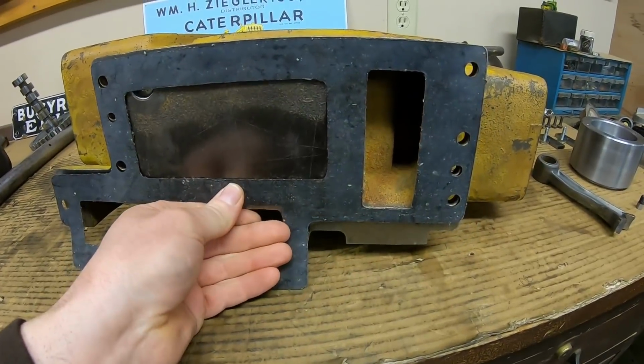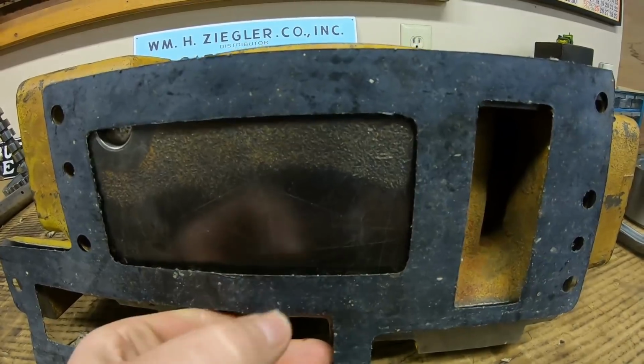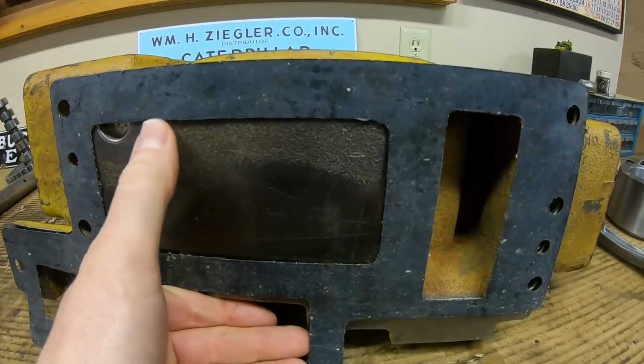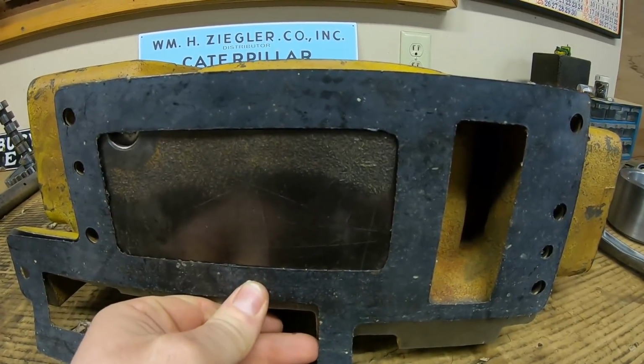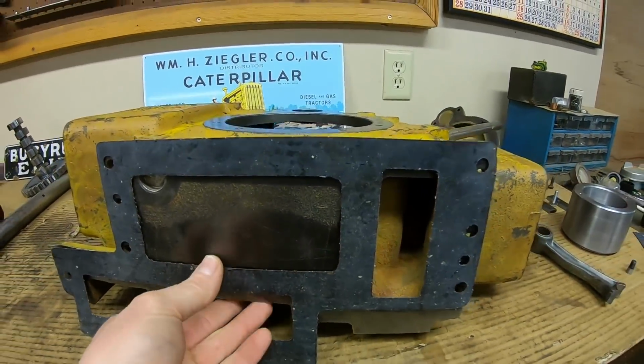I'll just line this old one in real quick. Everything around that crack is completely sealed against the top of the bell housing. So you could knock the whole floor of this crankcase out, it still wouldn't matter. It's all just going to be caught inside that gasket. So even if we do have any seepage through that crack, not gonna matter.